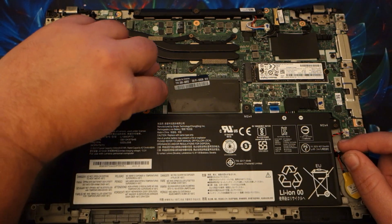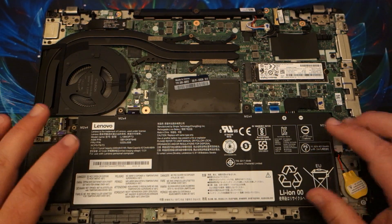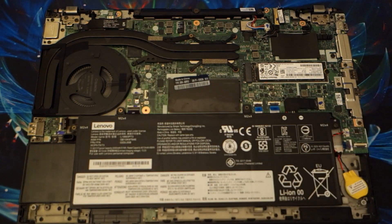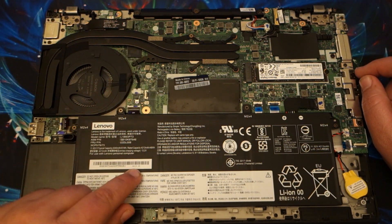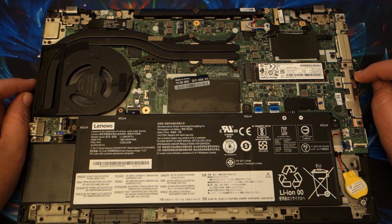I'm kind of interested to know what would go here — there's a little plug here. Obviously it has a nice big internal battery. One thing I've never thought about before: with the switch to internal batteries, there's a little hole in the case, and right underneath it is a reset button. If the laptop ever hangs, you can't just unplug power because you still have battery power, so you push this reset button. All it does is disconnect the laptop battery from the system board briefly to reset the system.